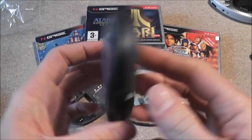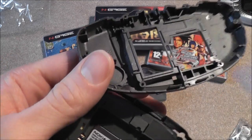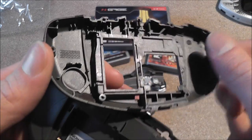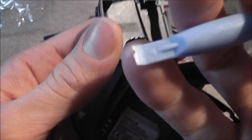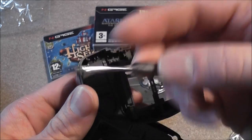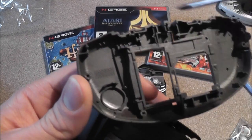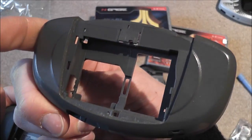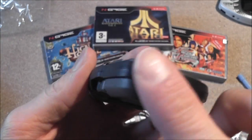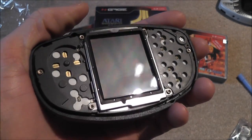I'll get back to putting the back cover onto the rest of the phone. That's the back plate back on now and it wasn't too difficult. It was a little bit tricky getting some components out — the speaker and the motor were quite difficult — but I used the prying tool that came with the replacement housing. I also used the small Torx screwdriver that came with it; there were just six screws holding the back plate on the original. I've also got the rubber housing section that goes around the outside of the phone on there. I'll clean the screen and get the front section on.